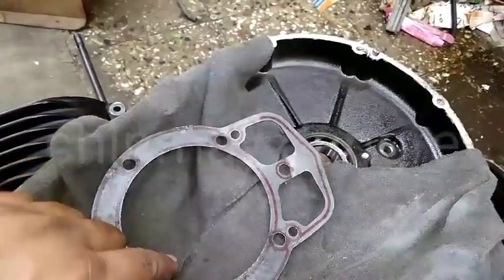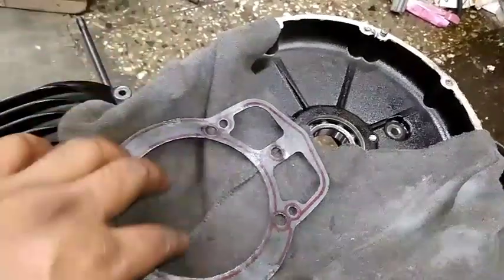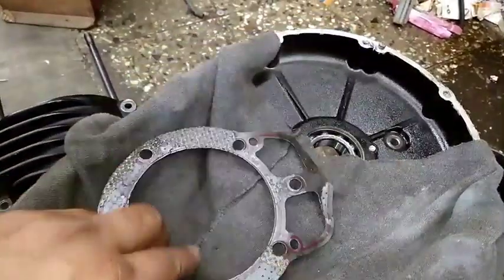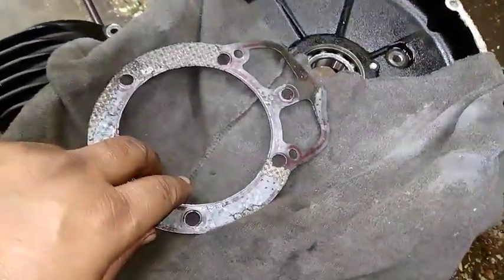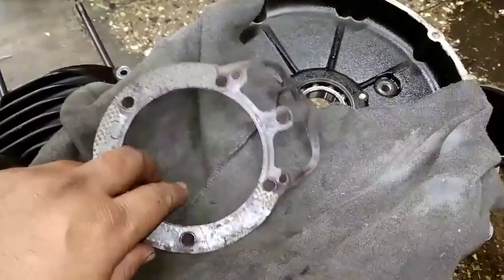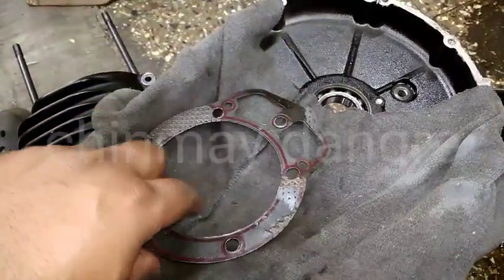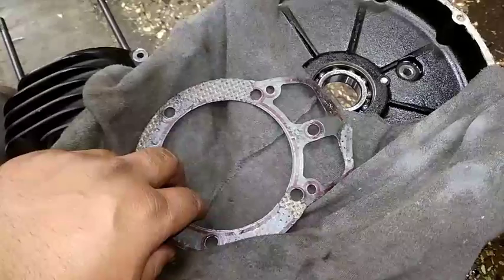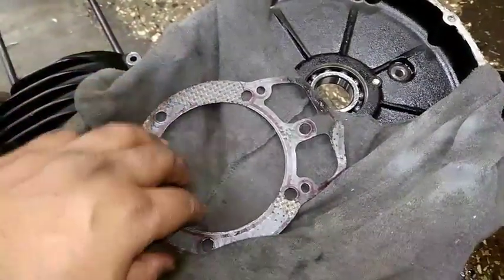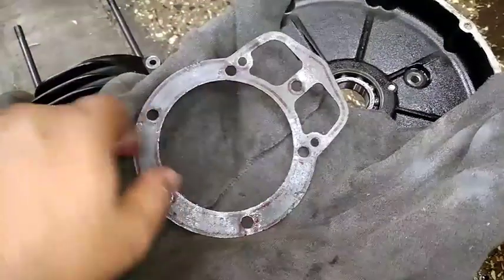After some more kilometers you will see no sweating, or just very light seepage — don't worry, it's not a leakage. But if you don't use an OEM product, it will keep on sweating all the time unless you replace it. Replacing such a packing is not easy, because this is not a two-stroke engine where you can lift the block immediately. You have to remove the rocker covers, rockers, push rods, and everything, and set the vehicle timing again — a lot of exercise is involved.